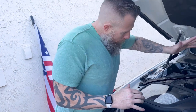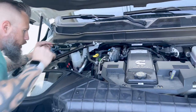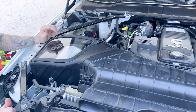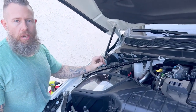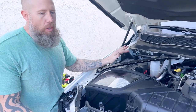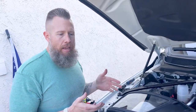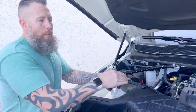Check all your connections — electrical as well — and make sure there are no air gaps, then start it up and check for any check engine lights. With the RAM, when you unplug both batteries it is going to throw a couple of sensor lights — traction control, stability control, and ABS. Do not freak out about that. Start the truck, let it run for a few minutes to initialize all those settings, and those lights should go away on their own.